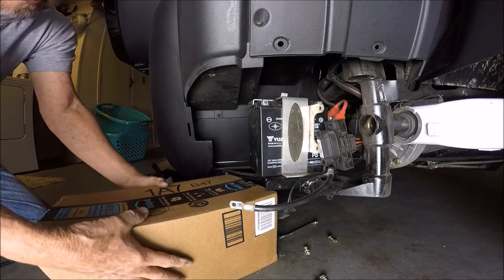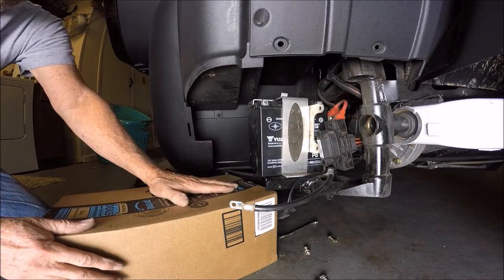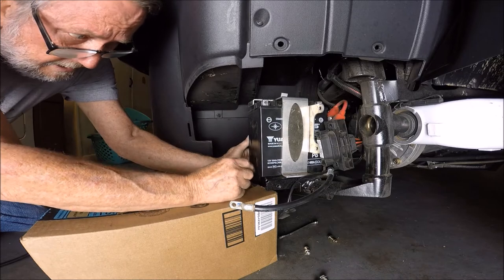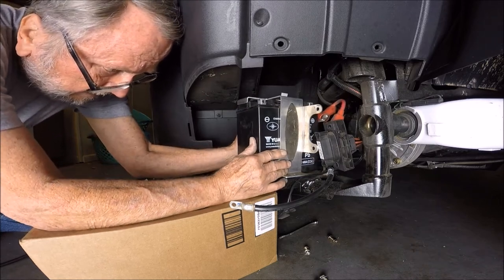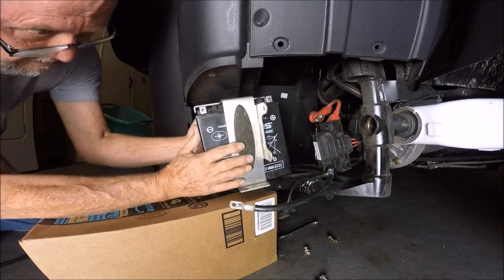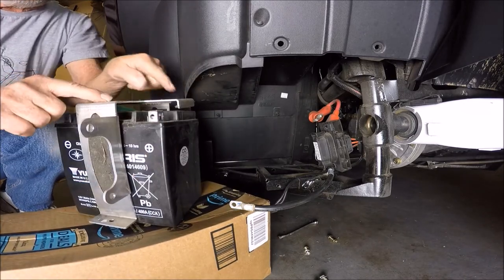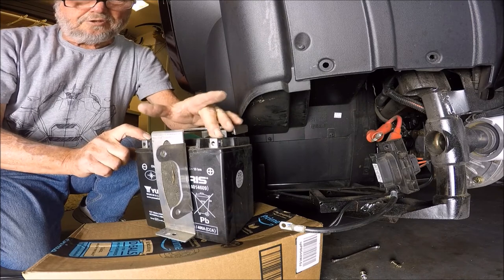Now I take this nut out — there's my connection — and I'm going to put this to the side to get the battery out. Get something that will allow you to slide the battery out onto it; I found this box that's the perfect height, and you probably have something in your house that will equally do it. On the back side, the tab hangs down for this bracket, so it's going to want to hit the metal. Take your finger and pull away as you guide and tip it, and you'll make it out. Don't let any material short across the two terminals — guard that very carefully.